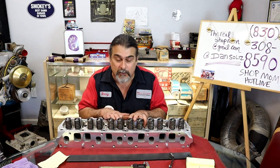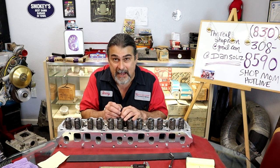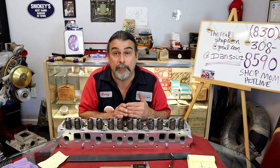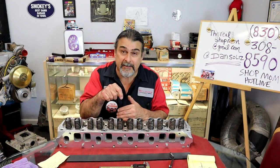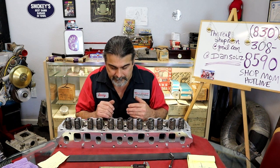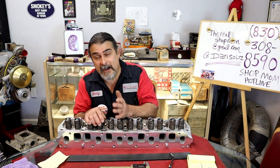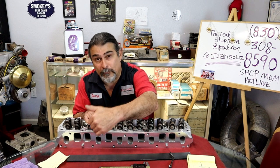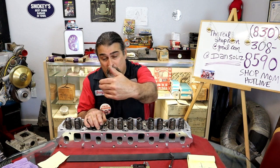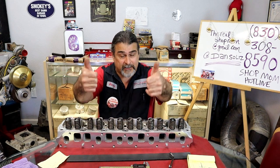So, once we're going down, this is the coarse thread. This isn't 3/8, this is 5/16. Once we're down to zero lash, we discussed zero lash already, we're gonna go about a half to 3/4 of a turn preload. I put a dial indicator on and I'll see how much that makes a difference, and I'll reference that. Generally on a 3/8-16, we want a half to 3/4 turn preload. You can do a full turn preload, anywhere in the half. Anything less than half, I know it's less than 20. Anything more than a full turn, I know it's more than 60. So that being said, 3/4 of a turn gets you where you wanna be.